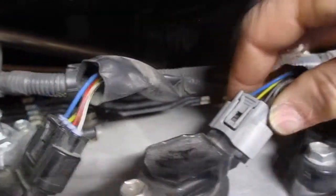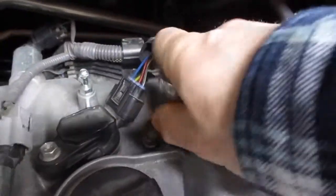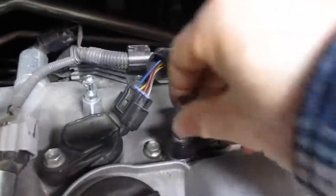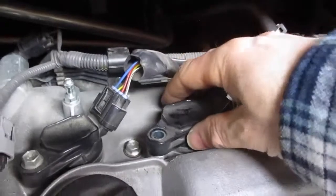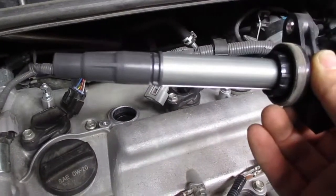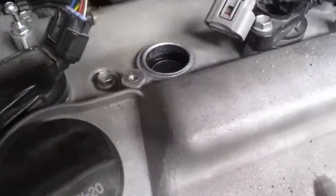I've got that loosened up. Once that's off, I'm going to use a 10 millimeter socket and we're just going to break that seal there, and then we'll just spin that off. Then we have a coil here — we'll lift that up, and that's taking the place of our spark plug cables or wires that used to run through the motor. Set that up here.